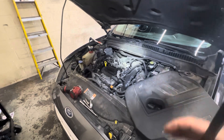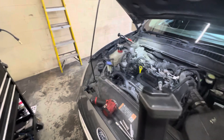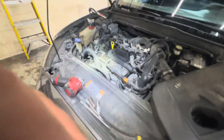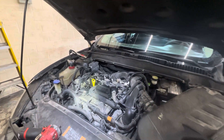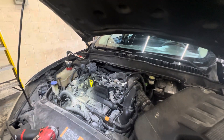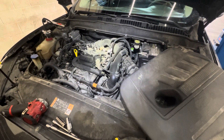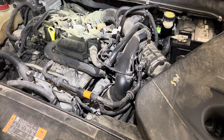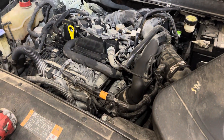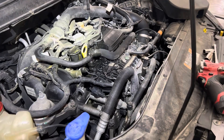What I am going after right now is the coolant. They said they filled up the coolant, a couple weeks later they had to add more coolant. I put a pressure tester on it and left it on there about an hour, raised it up, and looked for leaks. Couldn't find a leak externally. These engines are bad about head gaskets and coolant intrusions.